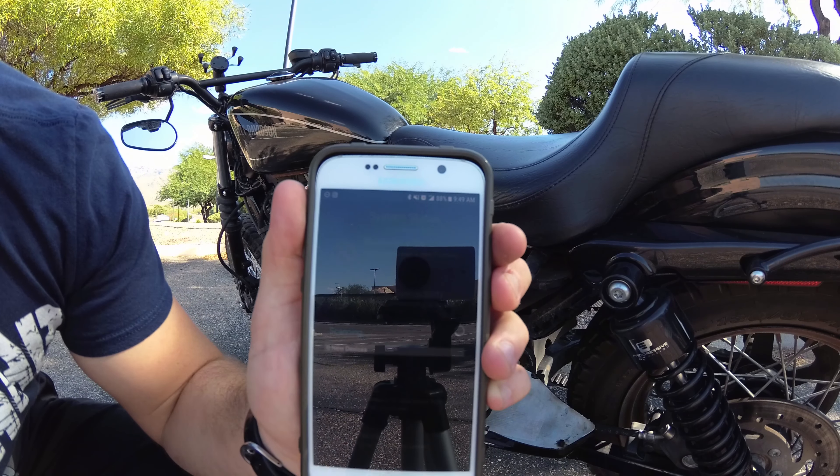Well guys, that is how you connect your Vance & Hines Fuel Pack FP3 to your bike. You can leave it on and do an Auto-Tune service, but if you don't have zip ties you don't want it bouncing around inside your battery case. Once you've mapped out the bike, you can take it off, put the black plug back into the ECM, put it all together, and set the Fuel Pack aside. That is how you flash your bike to a specific exhaust from Vance & Hines — or if you have a different exhaust, they recommend flashing to a map for a similar exhaust. I hope you enjoyed this video, thank you to GetLowered Cycles for sponsoring — ride safe, be protected, and I'll see you later.